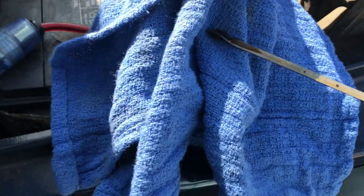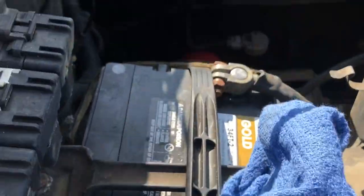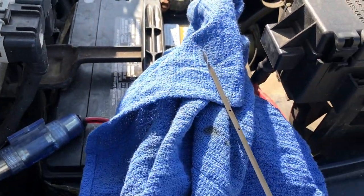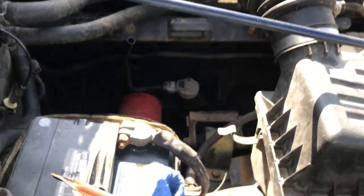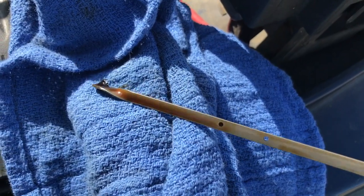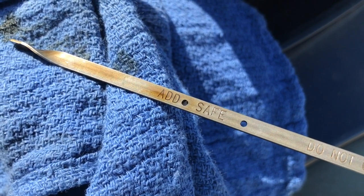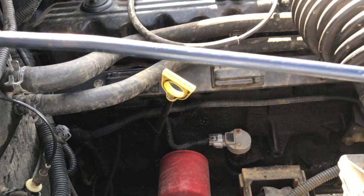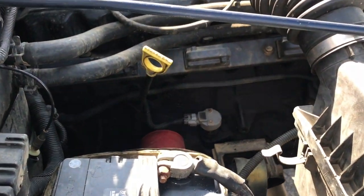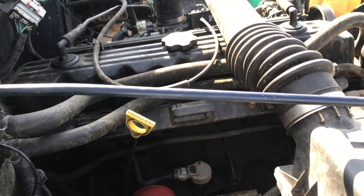You can see it goes all the way up and down the dipstick because the engine is running and moves oil around in your engine compartment, also up the dipstick chamber — that hollow tube I just removed the dipstick from. I'm gonna wipe this off, reinsert it, let that set for just a second, come back out and take a new look. Now there's definitive lines on the dipstick on both sides. My oil level looks like it's right above the 'add' but below the 'safe' wording, but it's between those two dots, which means I've got enough oil. Remember, my engine's warm right now, which means the oil level is probably gonna be a little bit lower on the dipstick than it would be if the engine was cold and all that oil had drained back down to the bottom. Keep that in mind when you're checking either a warm or cold engine.